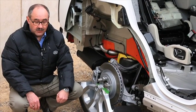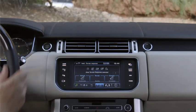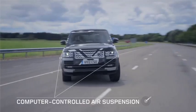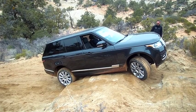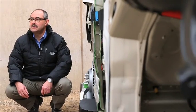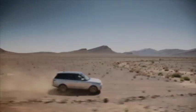One of the things that's necessary for good off-road performance is large wheel articulations and ground clearance. The air suspension allows you to have a variable ground clearance, so when you're trying to drive the car at speed on a highway, the car can be at a relatively low ride height, so the stability is good and the centre of gravity is low. When you want to go off-road, you want to raise the car, and the air suspension allows you to do that because you can adjust the ride height to suit the condition. The Range Rover has four separate ride height conditions for driving on and off-road.